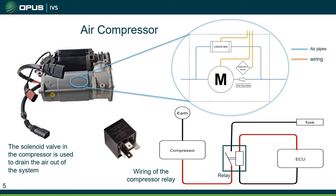The job of the air compressor is to build system pressure. On the compressor you have an intake, which takes new air into the system, and it will also be used as an exhaust to get rid of old air when you let the vehicle down. As the compressor is a moving component it is likely to wear and cause issues. One fault code we see quite often is thermal shut off — that's because the system has been trying to build pressure and the compressor has got hot because it's running but just can't build enough pressure. The normal working pressure I'd want to see is at least 8 bar.